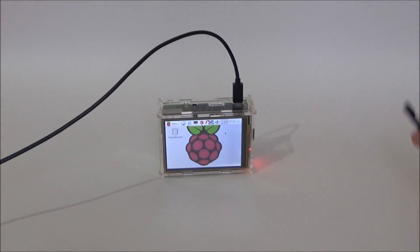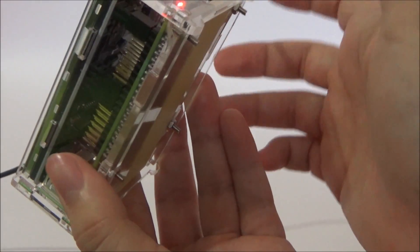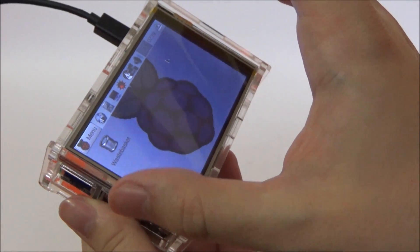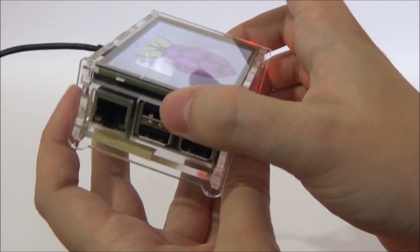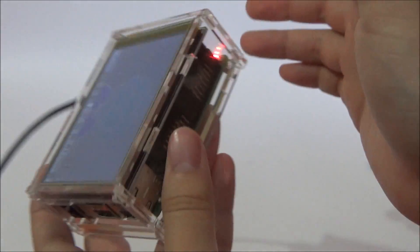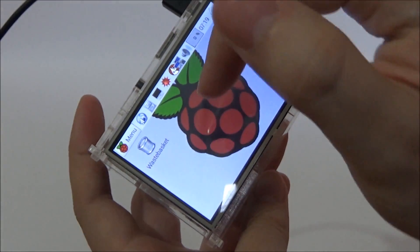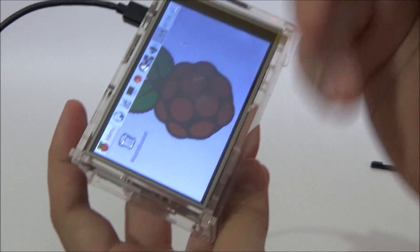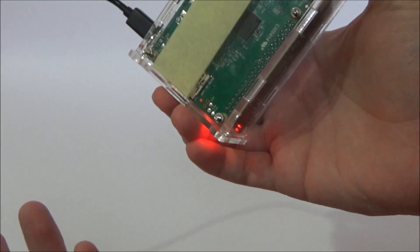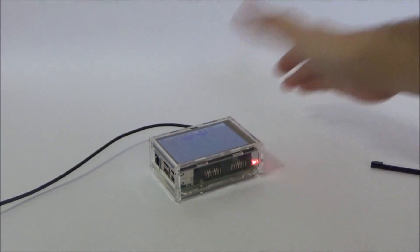And now for the setup part. This box is like IKEA furniture so you just have to put it together like a puzzle and when you do it, on top of that comes the screen. In order to be able to boot and use the screen you will have to download the special ISO file which contains the Raspbian operating system which has the drivers for this screen. I will put the link in the description and you will just have to flash it with Win32 Disk Imager. When you have finished doing that you just put it in your Raspberry Pi and boot it. It's actually that simple.